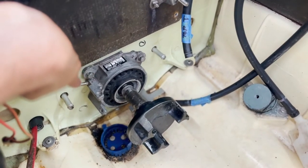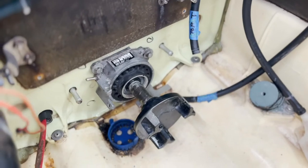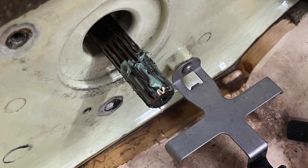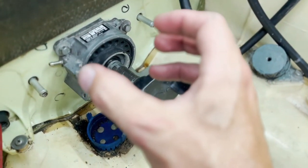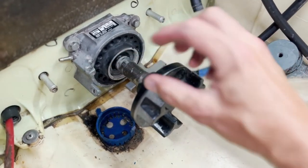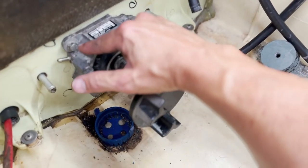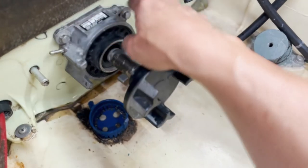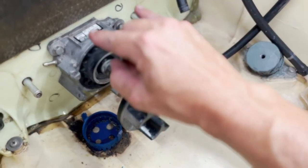There it is, installed back in place. I put a little bit of silicone around the back side of the coupler as a precaution to keep water from seeping through, and a little grease on the drive shaft and inside the mid shaft. When you go to put it on, you'll feel it go on and then feel like it stops. Reach behind, hold your drive shaft, and twist the coupler until the splines line up — then it will slip all the way on. There are little dowel pins that will line up with the bolt holes to guide it in.